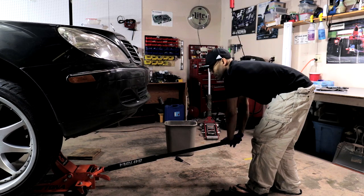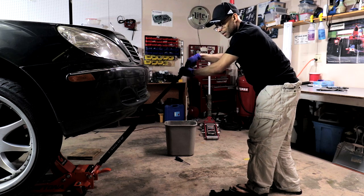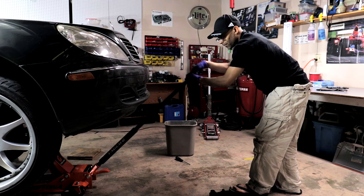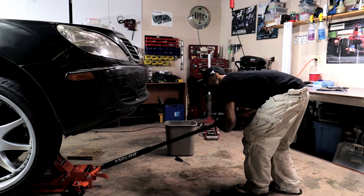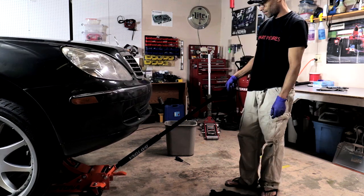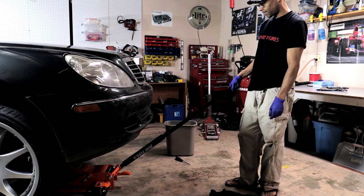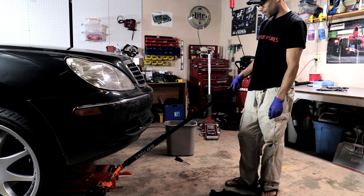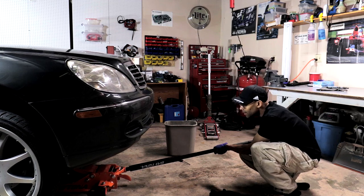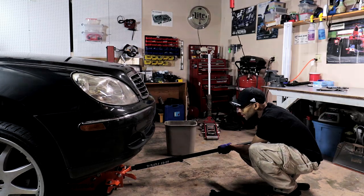air gap is gone. So it looks like between playing with the fluid level and just really getting as much air out as possible and just being patient with that, sometimes it's not going to be 15 pumps, but maybe even more. But yeah, getting the air out and also playing with the fluid is really what helps. So this is just a little quick tip for you guys.